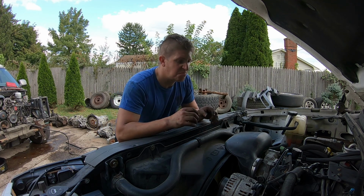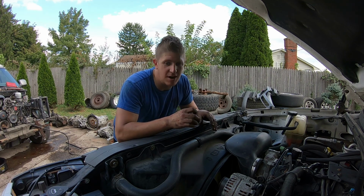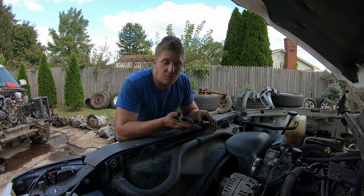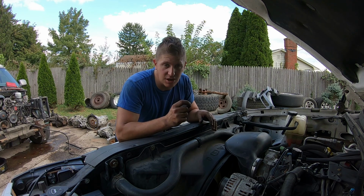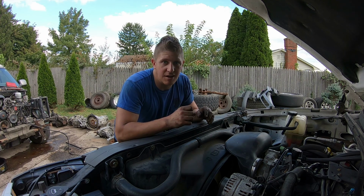It took me probably about 6 to 7 hours of diagnostic time to finally find that I, one, had a faulty multimeter, which is why the diagnostic took so long, but two, had a ground wire to the ignition coils that was broken inside of the insulation. So once I replaced that ground wire, it started right up, works and runs great. I haven't had it on the road yet, but it does drive well just on the private road here and back around the yard, around the shop.